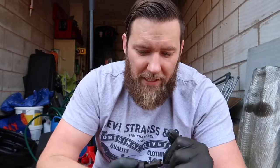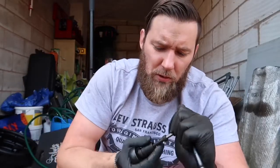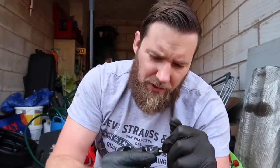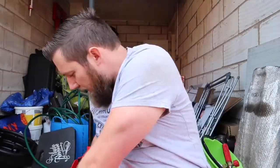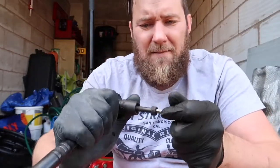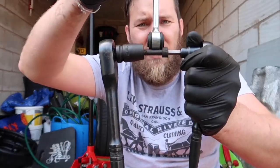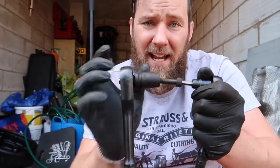like so, and that's as if I was putting it on the car. That's what I'm going to do when I put it on, just very gently and very slowly. I'm just going to nurse the bolt onto the nut. A new bolt, it actually cleaned up the threads for me, and I reckon if I get the drop link, so if I just have a look at this, I reckon that the nut will now go on far enough for me to get a nice purchase on it.